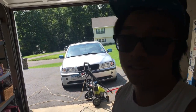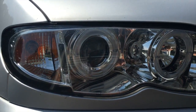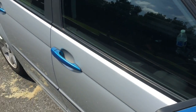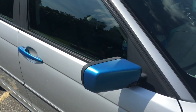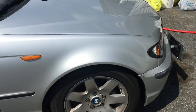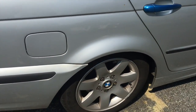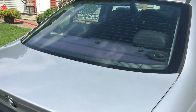Here's a quick rundown of my car and everything on it — nothing too crazy. I have a license plate tow hook holder, some chrome Spider Pro LED HID headlights from SpiderAuto.com which are awesome, and blue Plasti Dip on the mirrors and all the handles — a simple custom Plasti Dip job, just tape it off and take your time. The car is lowered on Raceland coilovers. One thing I had to do was upgrade all the strut mounts, because as soon as you switch to coilovers your strut mounts are going to blow.